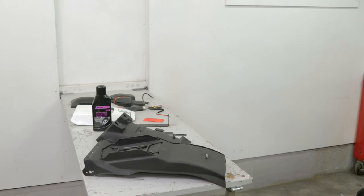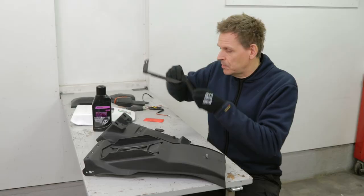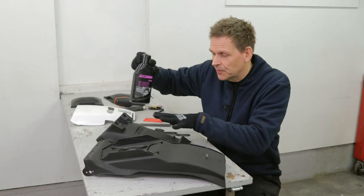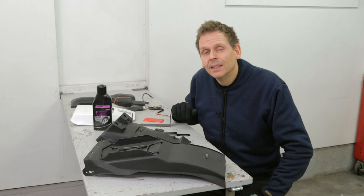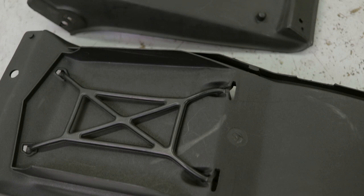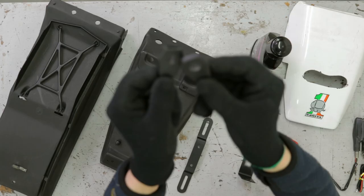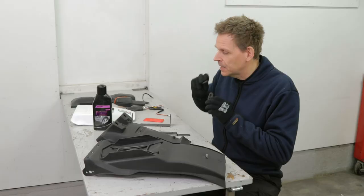It's time to take a look at the rear fender. I've taken off all the parts, made a proper cleaning, rust-protected and painted the metal parts, added plastic and rubber renewer — black pigmented on the plastic pieces. I highly recommend you do the same whenever you do a service, maintenance, or repairs — clean everything and make it look as good as you can before you reassemble. Much better to deal with clean parts. I've also 3D printed a couple of adapters for the indicators here as well, so let's start putting everything back on the bike and see if my plan works out.